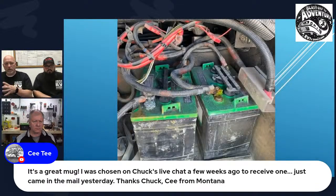Yep. And then that many batteries in play, or even if it's 4, if you don't take a picture or make yourself a map of where those battery connections went and don't mark them, we get that all the time. Somebody's pulled them out because they were used to doing it. Exactly. They pull them out to go and bench charge them or to keep them up to par. And then they don't know how it got wired back in. And then they're bringing it in where they've done, like you said, made 24 volts or made 18 volts and damaged something. So leave them in the coach is my advice, and cycle them.